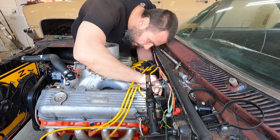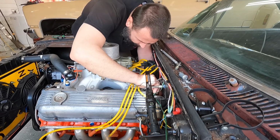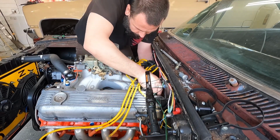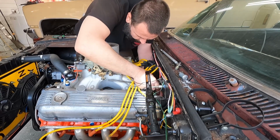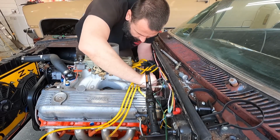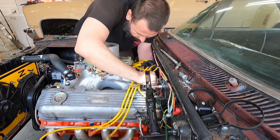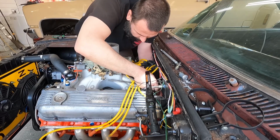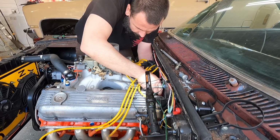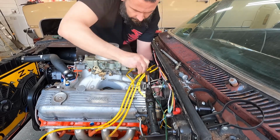Oh, and I do have clutch arm to first and reverse shift rod issues. It does hit, it hits pretty good. I clearanced the valve cover yesterday and I thought I was good, but now it's rubbing again, so I'm unsure what's moved, but I'm going to have to grind the valve cover some more. And then maybe have to... alright.